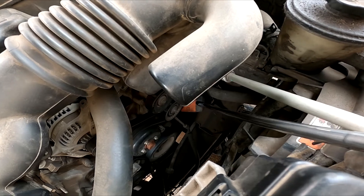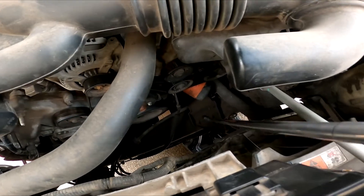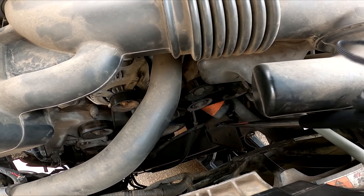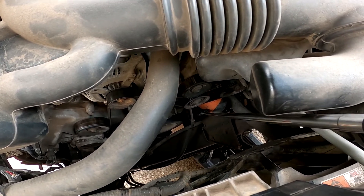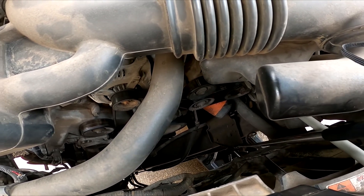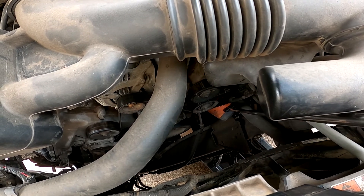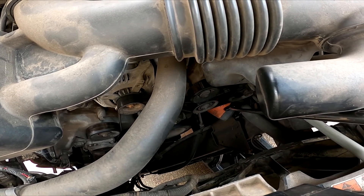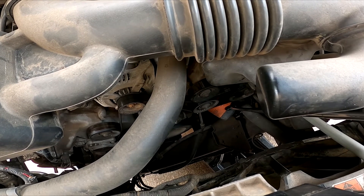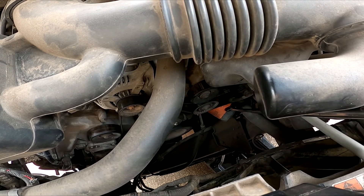There is your oil filter, accessible from the top. You'll see where my little pointer is — that's a catch tray for your oil. So when you undo the filter, the oil is going to go on that catch tray, and hopefully you put your pan in the right spot. You'll probably need an oil filter wrench to undo your oil filter — I'll put a link in the description below if you don't have one. I hand-tighten my old filters, so this should come off quite easily. Let's go ahead and get the oil filter off and put a new one on.